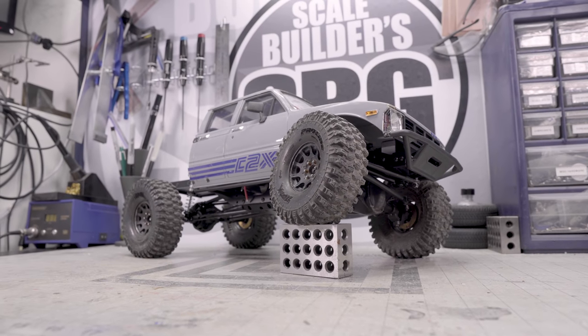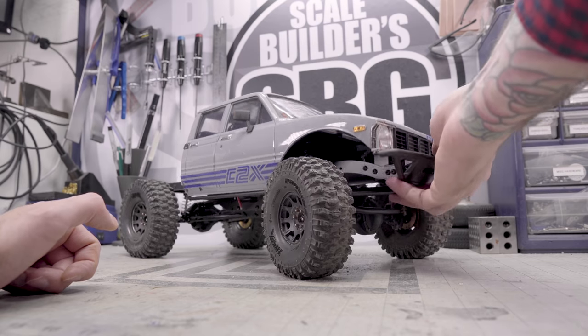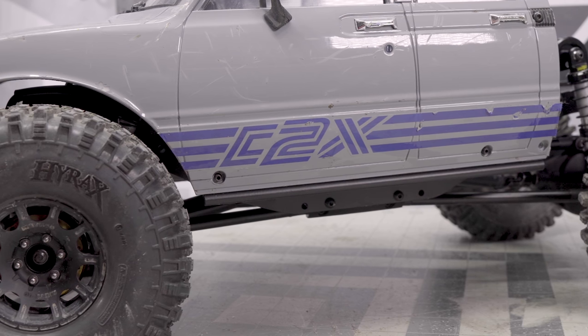There is room to mount something up there, but they didn't intend it to be a winch mount on top, so we're going to have to figure out a different way of getting a winch installed. Ultimately, because this is a comp-style truck, we're going to want a servo winch, which we'll have to figure out someplace on this chassis to tuck. We'll figure that out in a future episode. Moving down a little bit, the RC4WD tough armor sliders have been installed. These are specific to the C2X and they do a great job of tucking in nicely to the body contours. They run the whole length of the four-door body, so it is a pretty great looking slider. I am going to have to double-check the rules for Sorka to make sure they're Sorka compliant to get the full slider points, but I think they're pretty close. That's really going to help aid in performance — I love using a slider like this to pivot around an obstacle. That is an amazing way to save yourself a reverse or a winch.